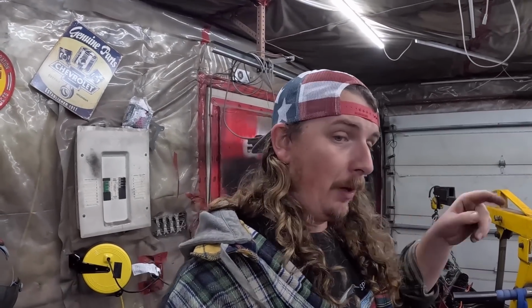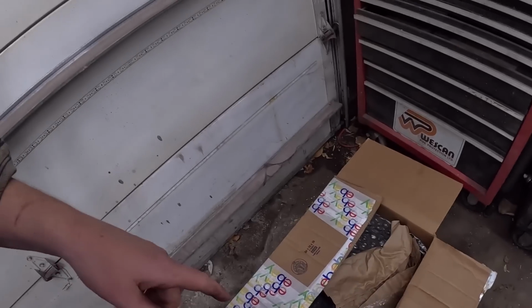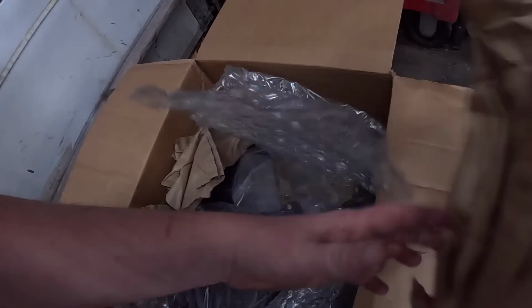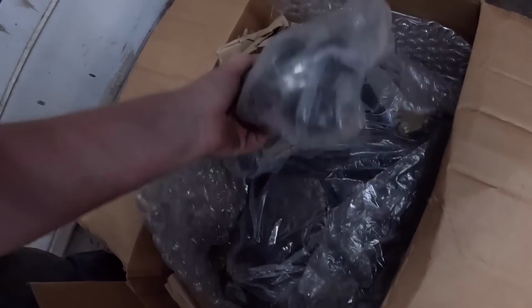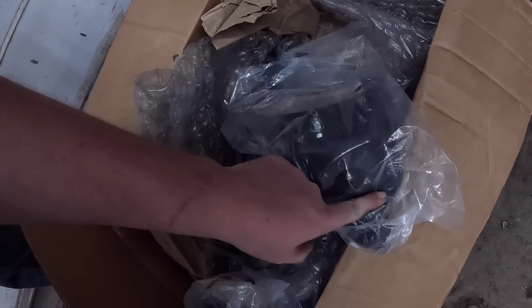And ball joints for this thing are like 50, 60 bucks a ball joint, plus bushings, plus, it's just an absolute nightmare. So I have found it's cheaper to go on eBay. As you can see here, hopefully my address and all my fears aren't written on this, and get these Chinese control arms. So they come, there's no bushings in them, they're tubular, they have ball joints, they just take Tri-5 ball joints. These are bolt-in.